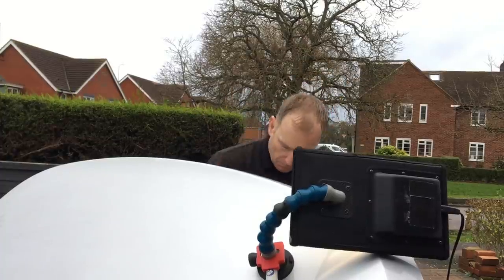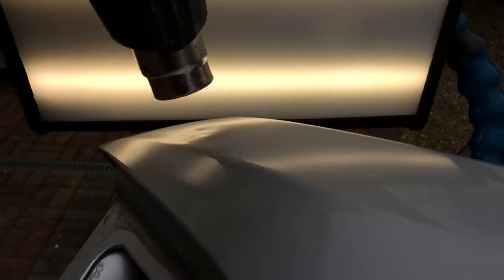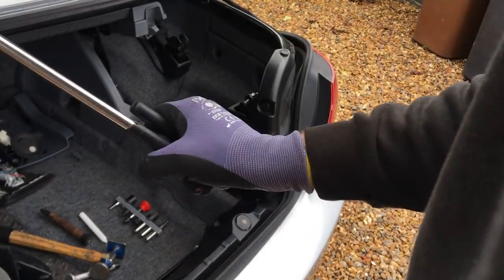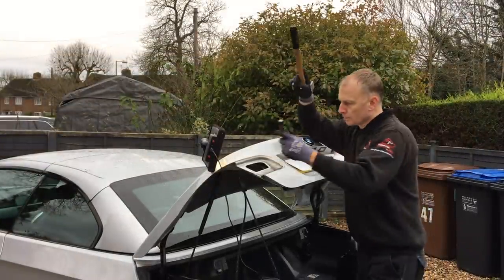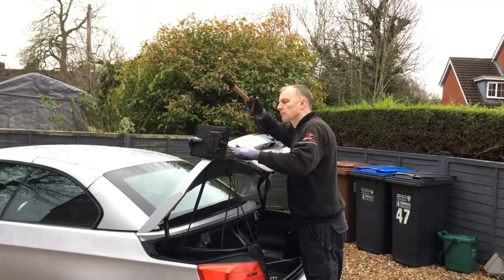It can take several passes to break the metal down. I go back in with the heat again to warm up the paint for more pushing. Using very controlled pushes, I start again at the top and gradually work my way down a third time — each time seeing an improvement. When tapping down the high areas this time I'm using my plastic bullet tip, which is tougher and more precise for the smaller high spots. So far I'm really pleased with the progress.